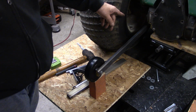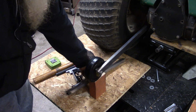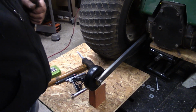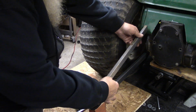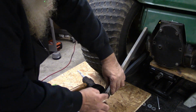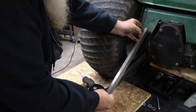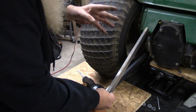All right, y'all. I got the other end bolted in there tight so it won't move. Got a bolt through this end down here, holding the tire on. Now we just need to make a brace, the top brace, and I think I'm going to start right here at this flat. Well, you guys can't even see where I'm talking about. There we go. All right, I'm going to start right here where it's flat, and that'll be the bottom edge of it, and I'm going to go like that, and I'm going to cut this piece here on an angle, and that way it'll sit right on top flat, and I'll make a bracket that comes off of this piece. We can weld right onto here by both sides, depending on what thickness material I find.